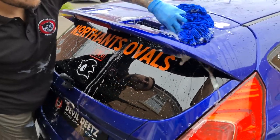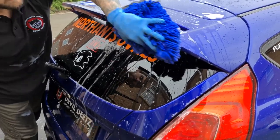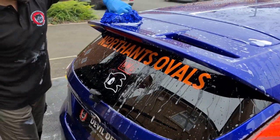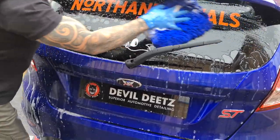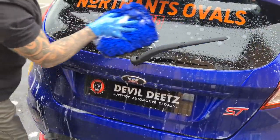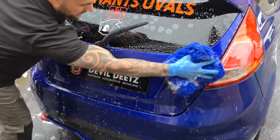And this is why you carry out such a thorough pre-wash — so that you minimise any surface contaminants, grit, grease or dirt before making contact. Meaning when you finally do make contact you're in a pretty safe place. I say minimise because you can't totally eradicate all contaminants.